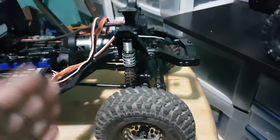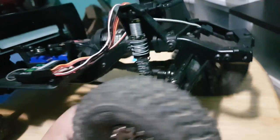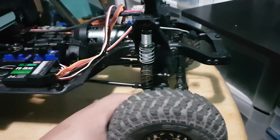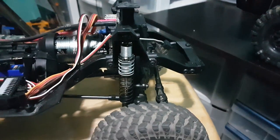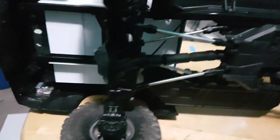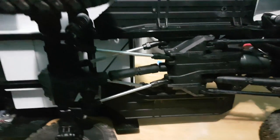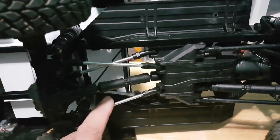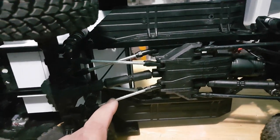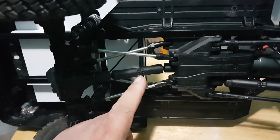The front end — all the suspension work from the front forward — is still all stock. I didn't change that because I can line the body up to the front suspension to keep all the geometry the same. It's easier to move the rear than the front. As for the rear, the links have been changed — for now it's threaded rod just so I can get the actual dimensions I need. Once I do some testing and make sure it's all good, these will be sent out to be machined by my good friend out of medical grade stainless steel.